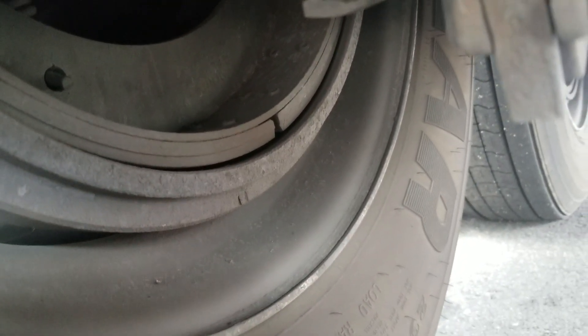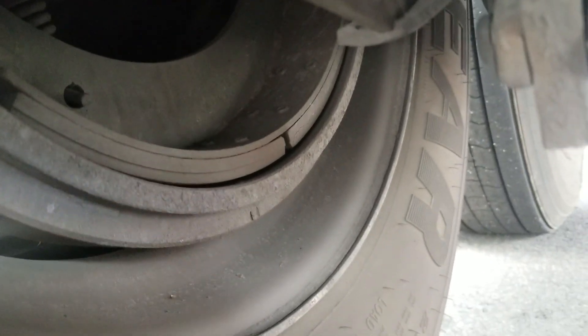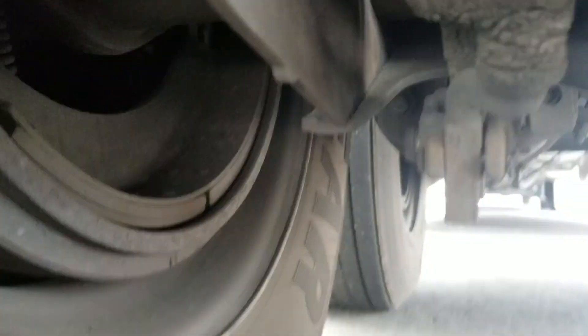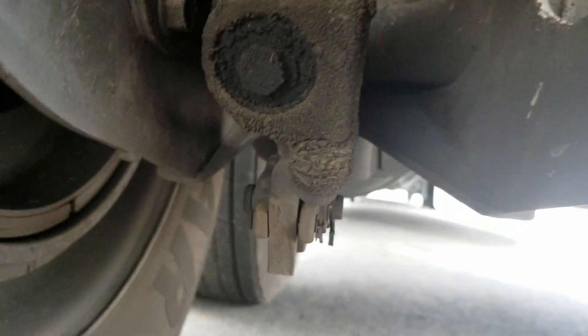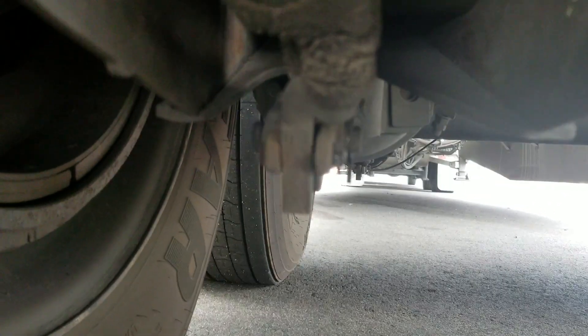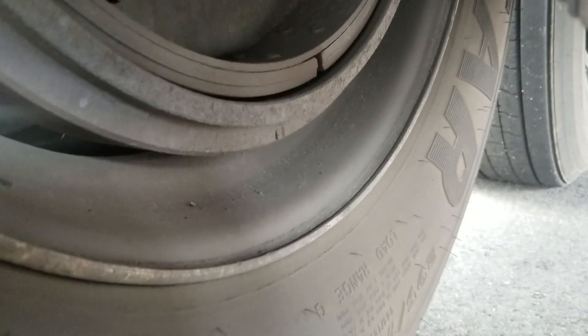In this case here, I got both my rear brakes. You see a gap there between the brake pad and the drum? If I see that, there's a pretty good chance I'm out of adjustment. There are differences with these slack adjusters, different part numbers. Some of them have long throws, some of them have short throws. My general rule here is if I can see a gap there, then I need to adjust them.